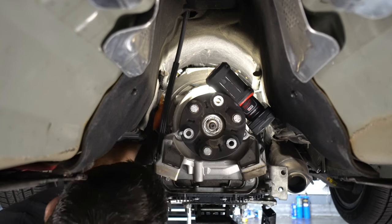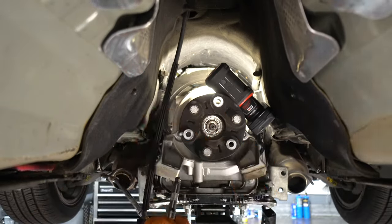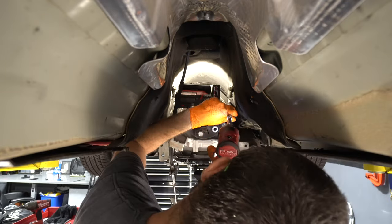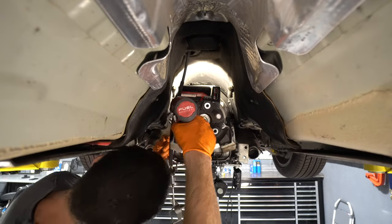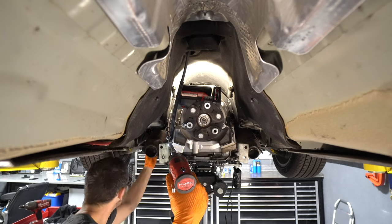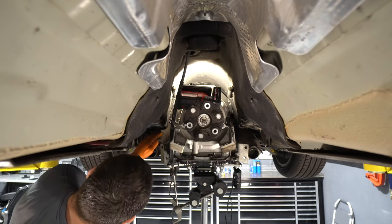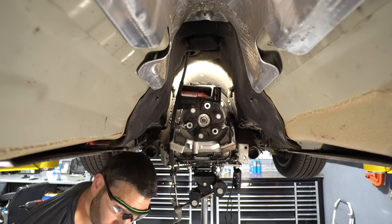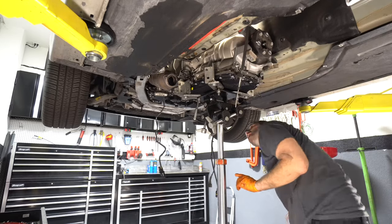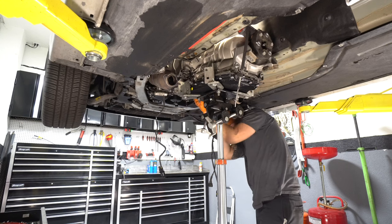You can see the bolts here are now visible — there are about 10 E12s and two E10s up on the top. There are two on the driver's side that have nuts on the back of them; you have to get a 15 millimeter on the back side, and there's a plate back there. I've got all the tranny bolts except for these two on the bottom already removed.